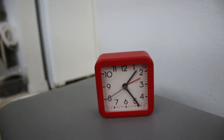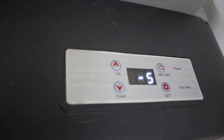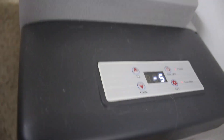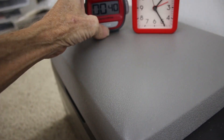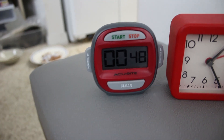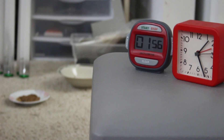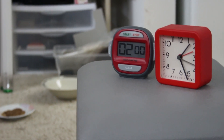A little over a day later — 25 hours — and this just shut off. I started a timer to see what the duty cycle is. With it off, it's only drawing half a watt, and with the compressor off it's starting to warm up. It'll probably get to plus 4 before turning back on. It's at zero and I just heard the compressor turn on — it was off for just under two minutes.